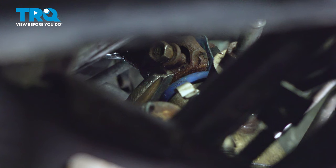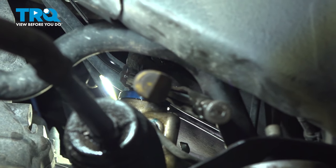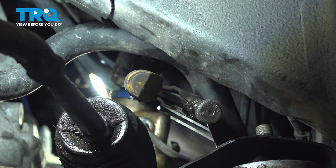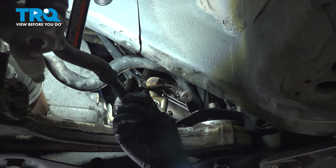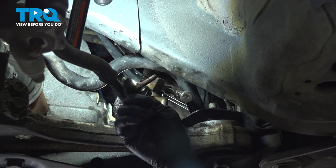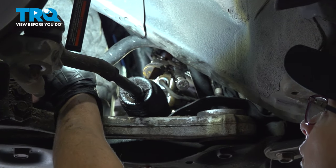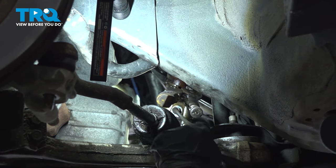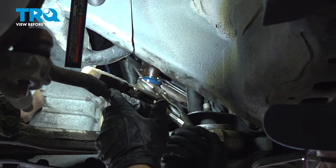Now, once I take the bolt out and I take the locking pliers off, I'm still going to lock that steering wheel in place because I don't want it to turn 360, because then you'll ruin your clock spring. So you want to put that seatbelt on that steering wheel. So I located those locking pliers on the back, and that made it able to loosen this bolt and spin it out. So here is our bolt that goes into the rack into the steering shaft. And because the link is disconnected, you have the freedom to move this arm up and down. So you can get those locking pliers right in there on the base, just like that.